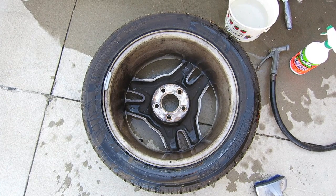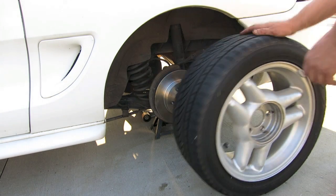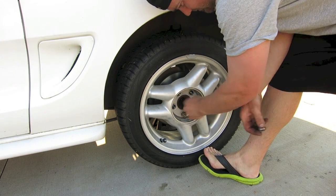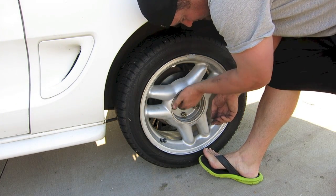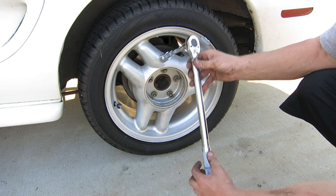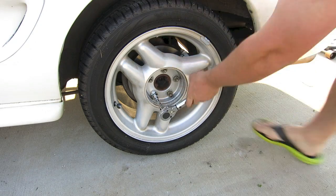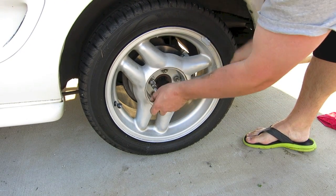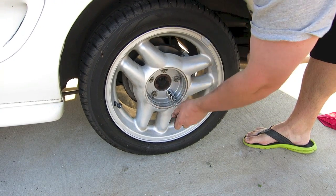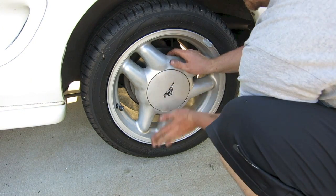As long as you've got your wheel off, this is the best time to clean it up. Then take that wheel and slide it on, take those lug nuts and put them back on to the studs. Take the four-way or air wrench and tighten them up. Once you lower the car, take a torque wrench set to 100 foot-pounds and go in a star pattern until it clicks, all the way around. Go around twice to check each bolt and click it at 100 pounds. Then take that center cap and press it on — and you are done.